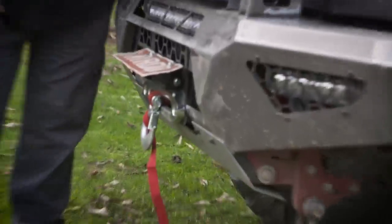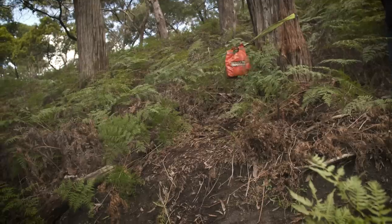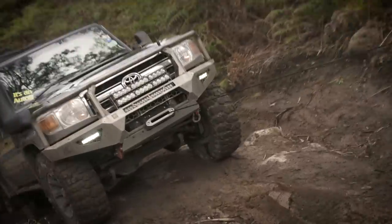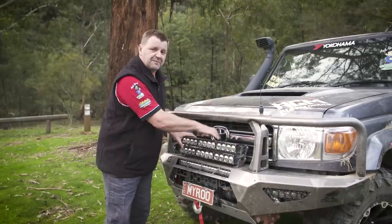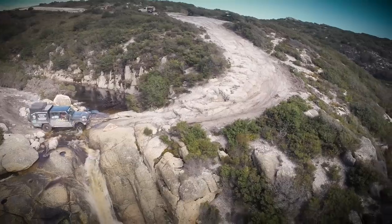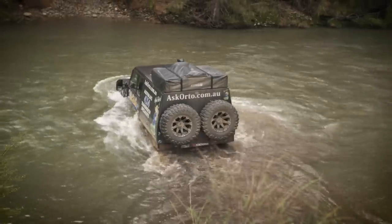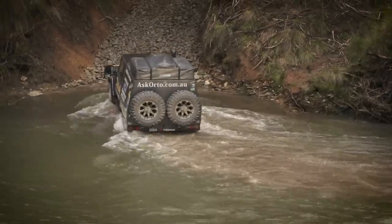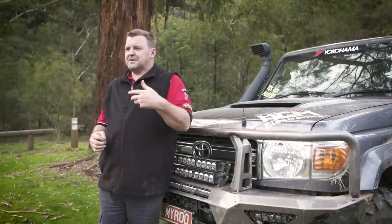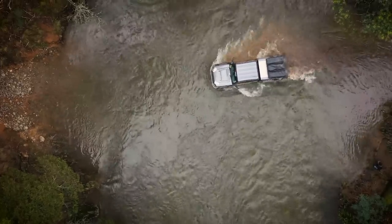With the new bar comes a flip number plate, and behind it is a King's Dominator winch — I've been using those for years. I actually mount the control box underneath the bonnet because my light bars leave no room up front, and I prefer the remote. For the UHF aerial, I like the little thin whip — when I'm looking out the windscreen I don't want a big black aerial in view. With the GME radio, I'm very close sighted so I have it at arm's reach up in the roof console so I can read the numbers.